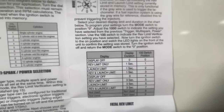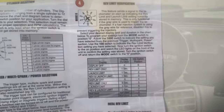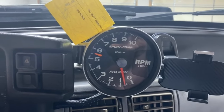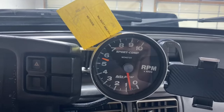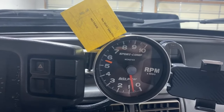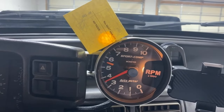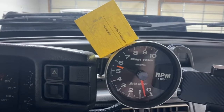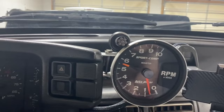So as long as it holds up, I am going to be a big proponent of this thing. Here's a demonstration of what I'm talking about — it should jump up to about 6200 for just a second, and then it's going to fall back down to 3500. That's your high side and your low side. Pretty cool — it verifies that your settings are correct, so you're not guessing and you're not worrying and you're not making a mistake.